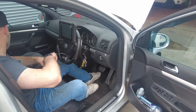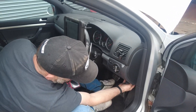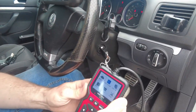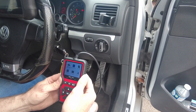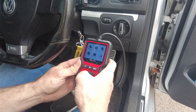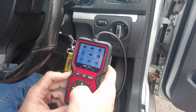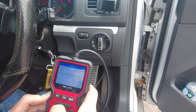eBay special? T-Move special — sorry, T-Move. It's got a lot of weight to it. Does it power itself from the OBD? It does! Nice little display. OBD, data stream — just a DTC library, voltage, setup. Click okay — it's going to do CAN protocol. One code found. Read DTC — it's very quick. Mass air flow. So that's the same code that we got from the Autel.